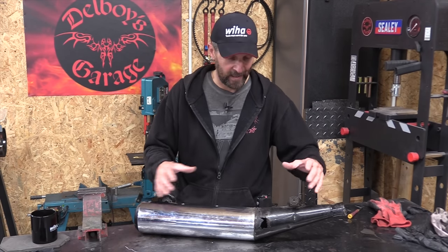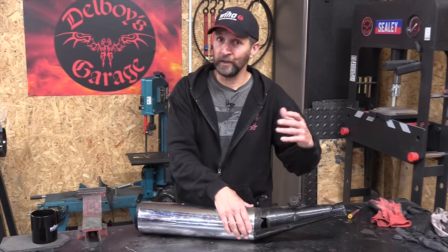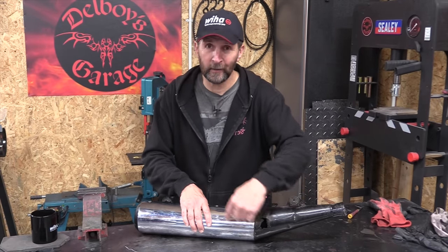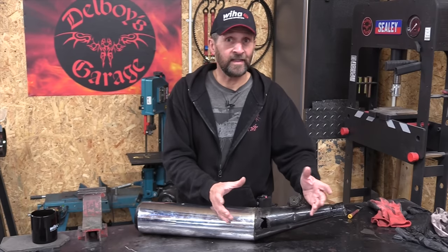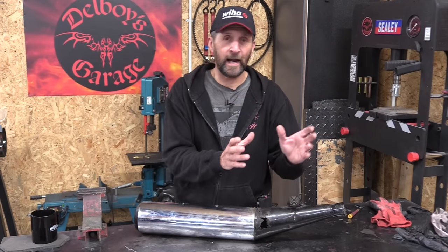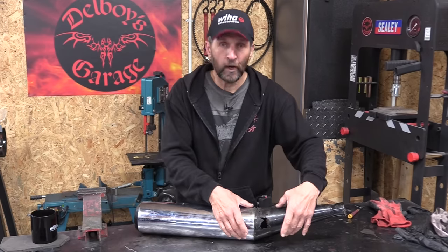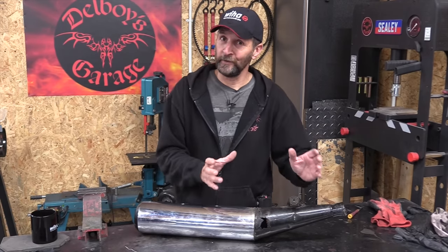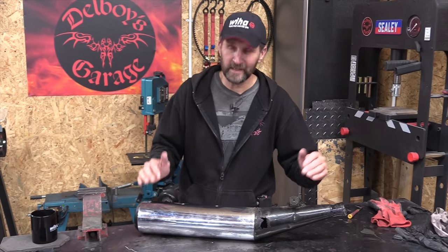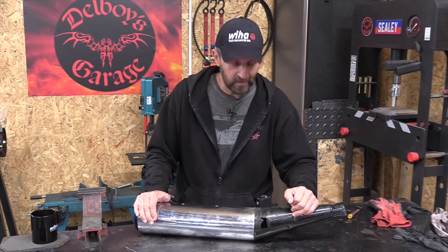And the easiest way to do that is to treat that rusty hole like you would on a rusty old car body by patching it. I'm gonna see if I can grind back with a grinder to good metal. That's if there is any. And if there is, and it's good enough to weld to, then I'll make a little patch on the English wheel, put it over the top and plate it over. And that hopefully should get me into the winter, maybe even through the winter, and I can replace the system in the spring. So let's see how we get on.